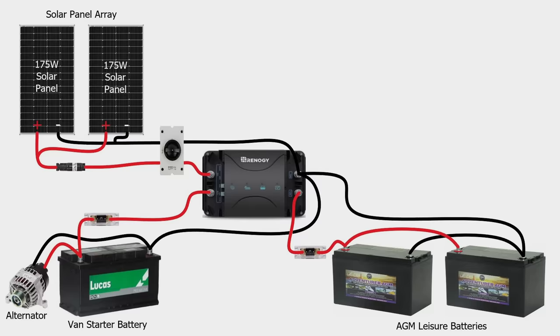For cable sizes on the solar side, the 4mm PV cables that come fitted to the solar panels are adequate for individual panels. But when we wire them in parallel the amps get added together, so on the single cable the amps will be in excess of 20 amps — we need to increase that to a 6mm PV cable. The fuse in the common positive is going to be a 30 amp inline fuse, which is about the maximum rating for MC4 connectors, so you wouldn't want many more panels in parallel than that. The rating of the double pole isolator needs to be above the rating of any fuses — as a minimum I would go for a 32 amp rated isolator. Cables and switches always need to be rated higher than the fuse rating; the fuse needs to blow first to protect all the other elements in the system.